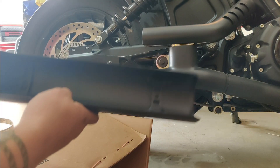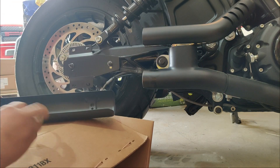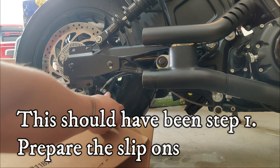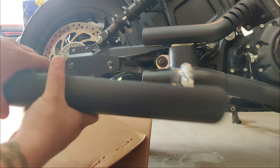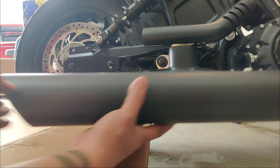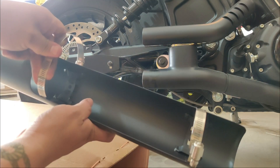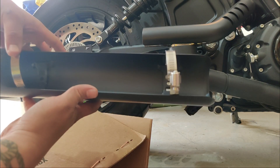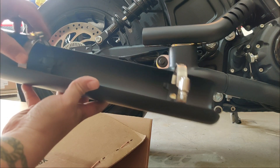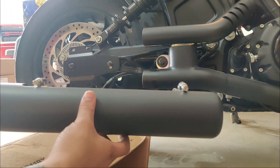This is one of the heat shields. The hose clamps are going to go right through here facing up so you can secure it — the open part is going to be like that, so you can secure it right here and have easy access to it. Once you have your hose clamps installed, you can go ahead and put in your actual muffler.